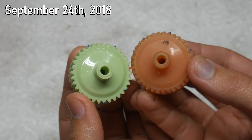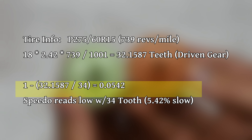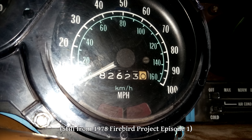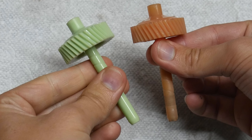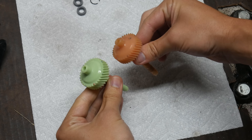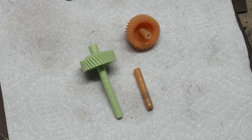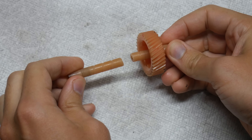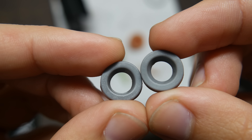Since we're not currently changing the drive gear, we'll just get the driven gear with the fewest teeth to get as close as possible. Our old orange gear was a 35-tooth, and this light green gear is the smallest they make at 34 teeth. So the speedometer still won't be quite right, but the gear change is at least pushing it in the right direction — the speedometer will read about 5.5% slow, meaning the odometer will read low, though it was before too. Also, it's worth noting that the old gear snapped in half when it rolled off the table — the plastic had become very brittle over the years, which is another good reason to replace it.